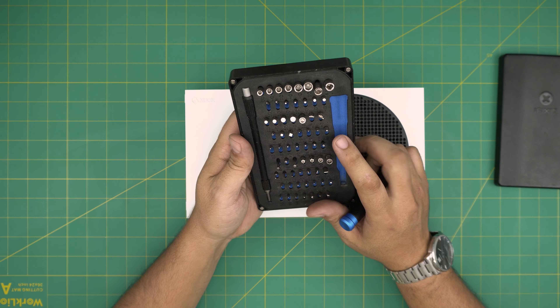Now we're going to remove all the screws. The green screws are the longest and only go in one place — you cannot mix a long green screw with a short one. The short screws go in the short spots. Don't worry about mismatching the places, just remove all the screws. The black screws only go on the Xbox X-clamp, so remember that. Keep the screws in separate piles sorted by color.